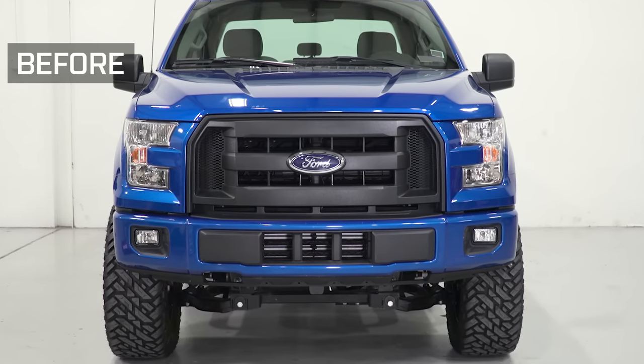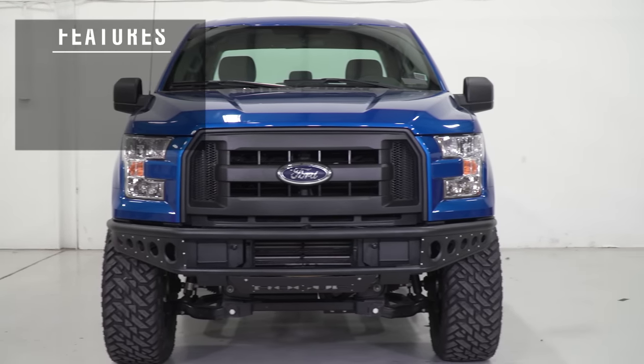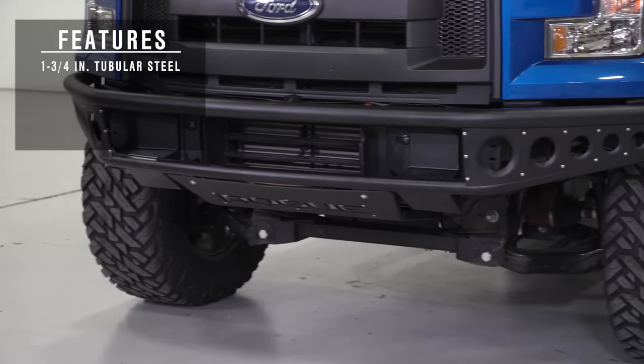But what if you want a little bit more versatility or functionality out of your front bumper in addition to that awesome pre-runner look? For that, I really like the Rogue Racing Rebel with the dimple side skins. Like the Barricade, the Rogue Racing is one of the most popular in the category, and in my opinion will offer a great balance of functionality, look, and price. When you make the switch to a bumper like this — whether it be Rogue, ADD, Fab 4s, or whatever — the price tends to climb dramatically over your entry-level options like the Barricade. But in return, you're getting a really well-made part with a bunch of versatility for about the $1,500 price point. You're looking at a combination of one-and-three-quarter-inch tubular steel for the lateral mains, in addition to a burly 3/16-inch-thick aluminum skid plate that absolutely dwarfs the factory piece, offering loads more protection upfront for the guys who take their rigs off-road and aren't afraid to occasionally send it.